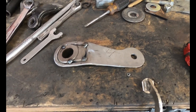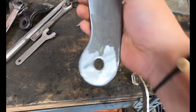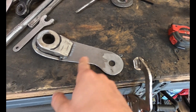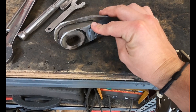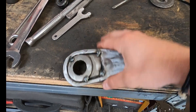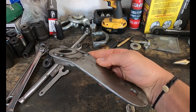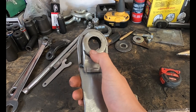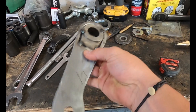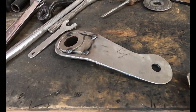The stroke is eight inches, so we're right on target. Now that we got our pitman arm mocked up the way we want with plenty of weld surface, we need to duplicate another one of these plates to make the bottom side of our double shear pitman arm. It's very similar to the GenRight design that they sell for $400, but I can make it out of scrap — literally had a scrap pitman arm and scrap plate laying around. Better option than $400 for something I can make in the garage.